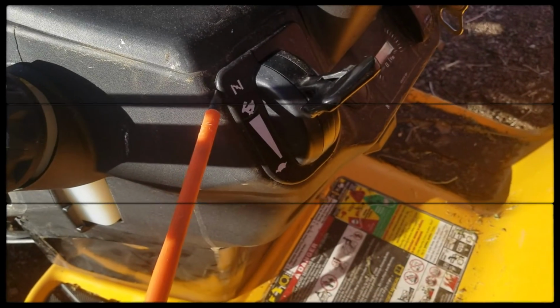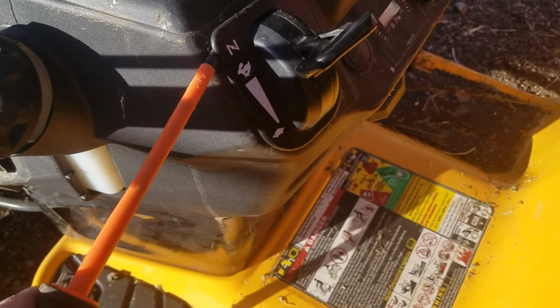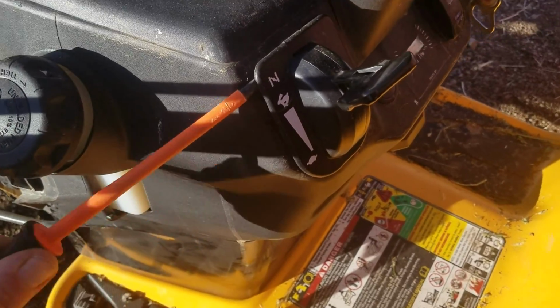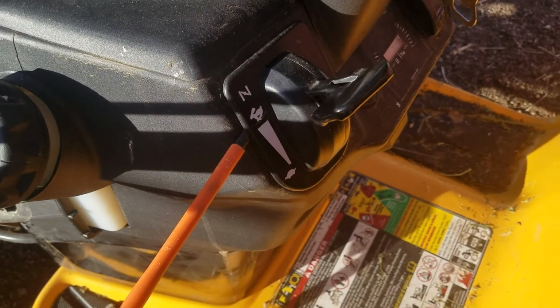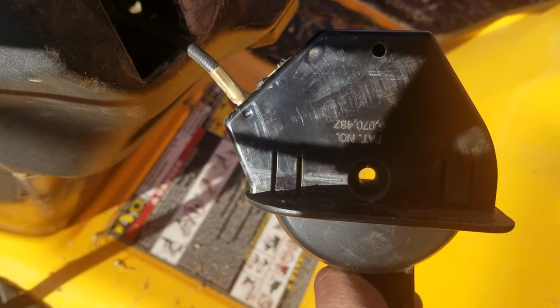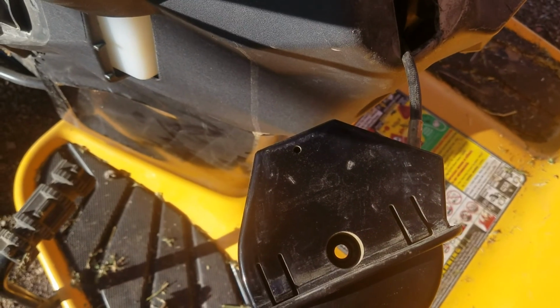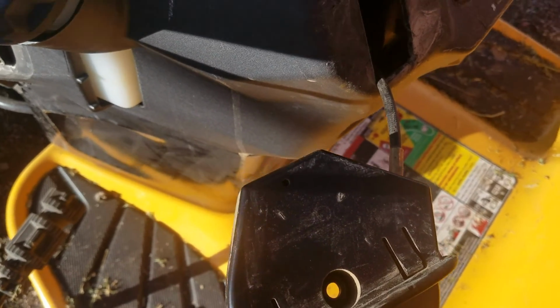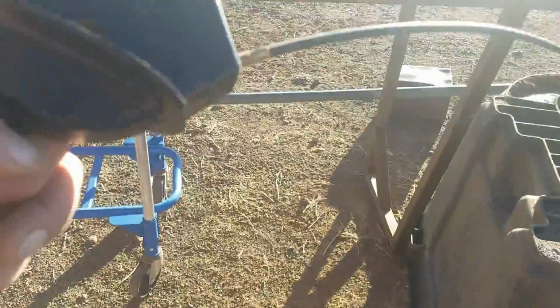So what you have to do is you go with a flathead in here and carefully disengage the snappers. I have to do this with two hands, so let me work on that. And I disengage now the snappers. As you can see, these are plastic snappers. They're on both ends. If you do it carefully, it goes right out and lets you take out the entire unit.